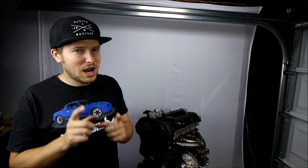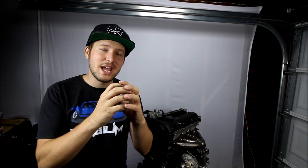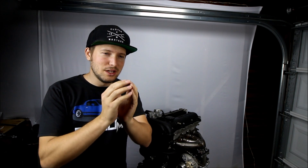I'm sure a lot of you are saying, well, that's easy — it's to cool the turbo down, the CHRA specifically, the bearings. But that's not the true reason why some turbos have water lines, and I say 'some' because there are turbos that are oil-only, so why don't they need water? The main reason is actually after you shut the car off — it helps the heat in the CHRA dissipate through the water in the lines. The water's not even flowing anymore but it's still serving a very important purpose: it helps the oil not coke — basically not bake inside the bearings — helping that heat dissipate through the water instead, pretty much alleviating the need for those old-school things called turbo timers.